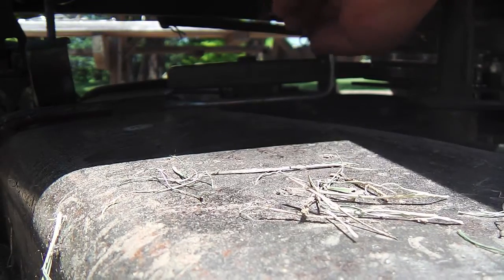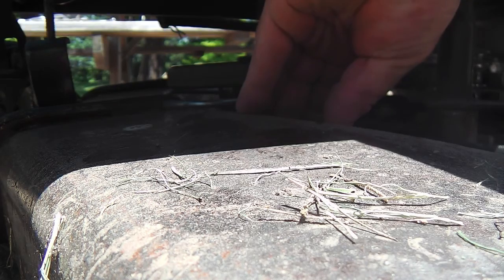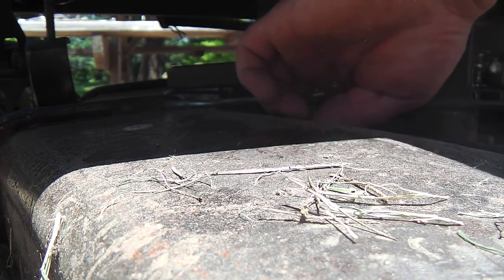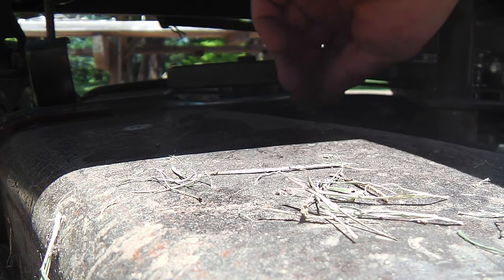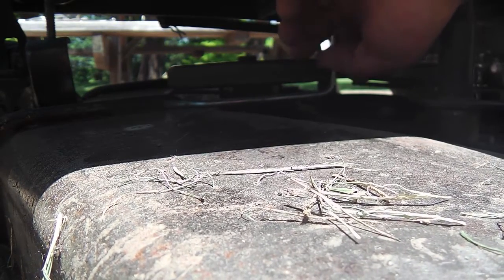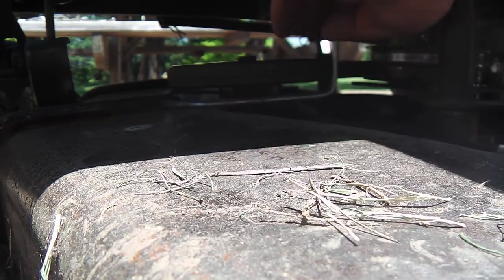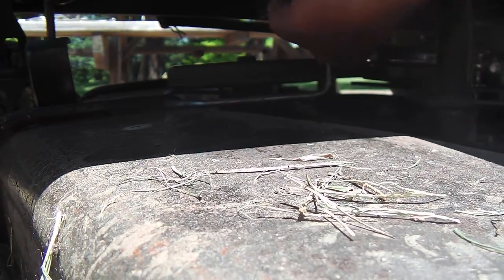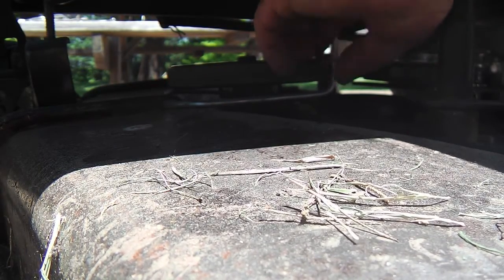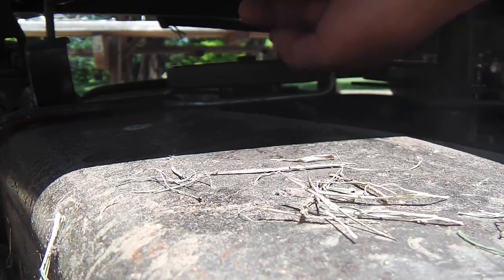These keepers for the belt. I didn't follow the example from the other deck, which was to just have some tabs bolted into the bottom, and then you needed a wrench to adjust them. These little keepers are round, so they won't grate on the belt. Plus, they're just bendable. You can bend them up, down, forward, back, and that makes an easy tool-free way to get belts up and around these things. They just get out of your way, or they'll do what you want.